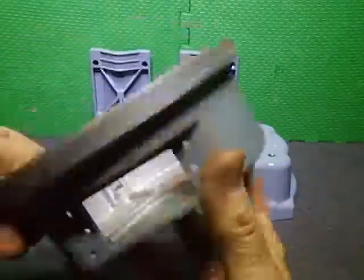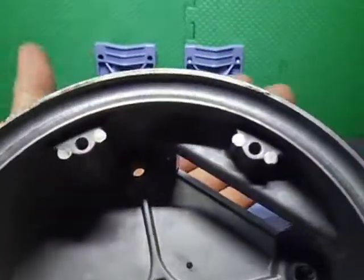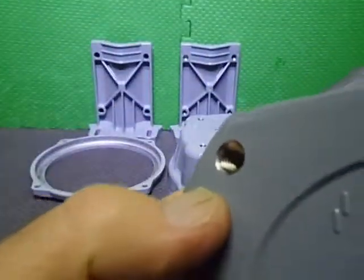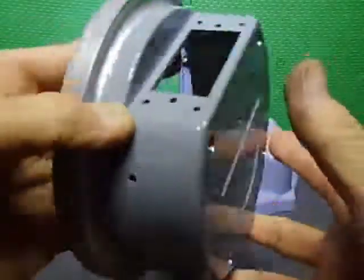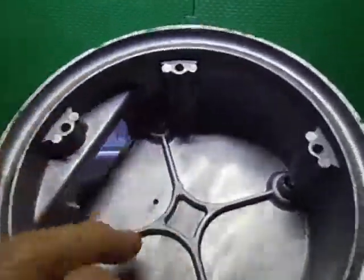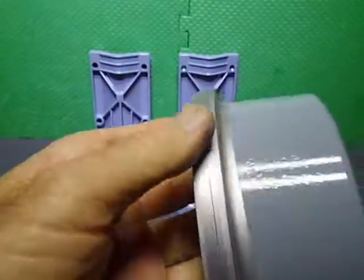There was a slight crack in the top of one of these - someone put too long a bolt in. I drilled them straight out and put recoils in these as well, you can see they're nice and shiny. The bearing on the inside wasn't glass bead blasted, but the track is in pretty good condition. I've done a light polish up of the bottom track since it got hit with the glass bead blasting.